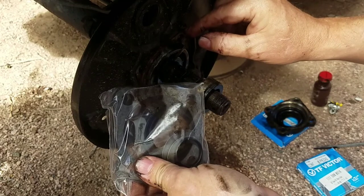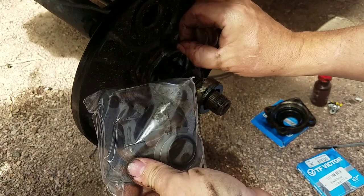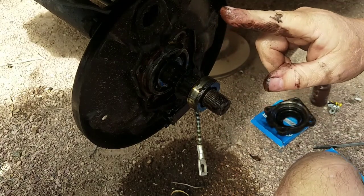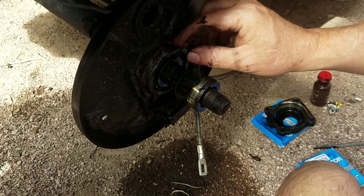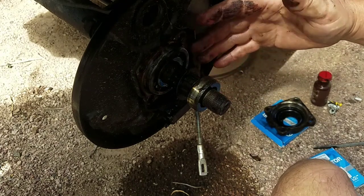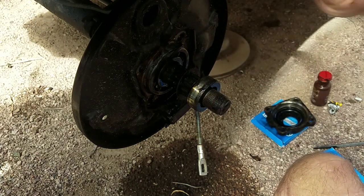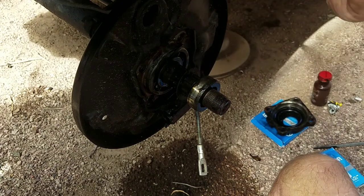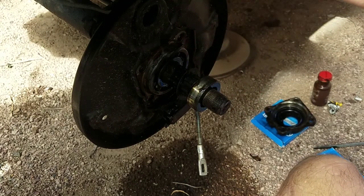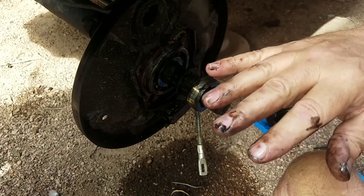The problem is there'll be a debate over this on how you shim these. They were shimmed with these gaskets to get the proper bearing thrust. But the big issue since the early 80s is people think this is the only place where you shim it, and that's not true. There's shimming that needs to be done on the axle itself. To do this properly, you practically need to take it to a full-service transmission shop because I don't even remember how to measure that tolerance.